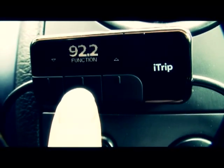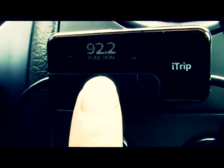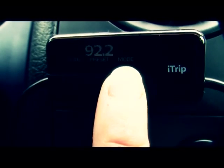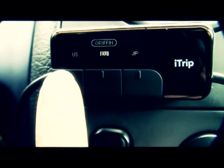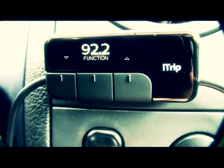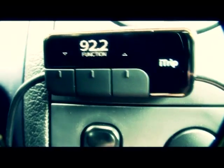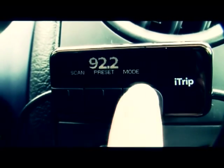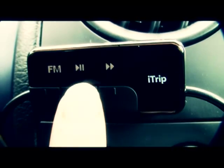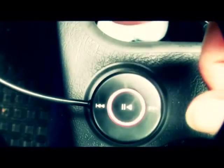The Griffin manual is not very precise, so I'm going to show you some little tricks that might help some people. If you choose 'function' and hold 'mode' pressed then let it go, you can choose US, Euro, or Japan — so you have many more frequencies available. For Japan it goes down to 76, I think. Another thing: if you choose 'function,' go to 'mode,' and push the middle button so the Griffin sign is no longer lit, you can also use this little box as a remote — which is also not in the manual. You can start, stop, or whatever, from up here or from the plug in the cigarette lighter, so you have two ways to do it.